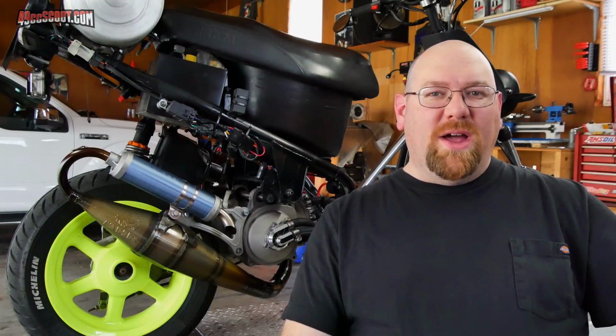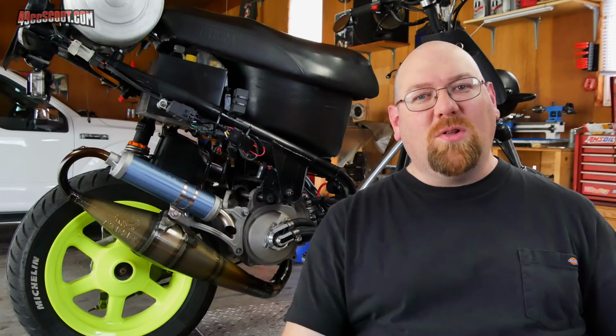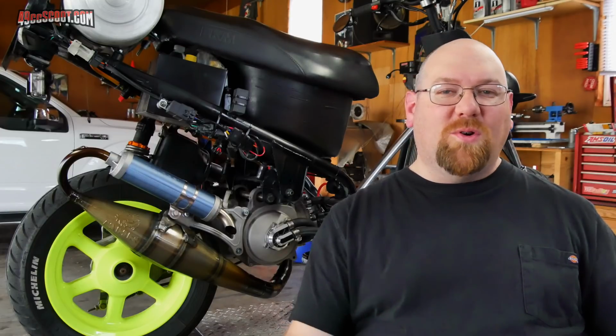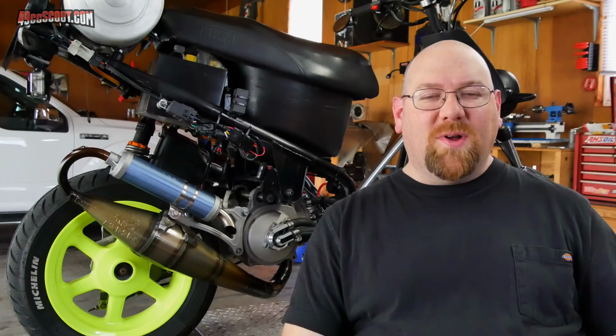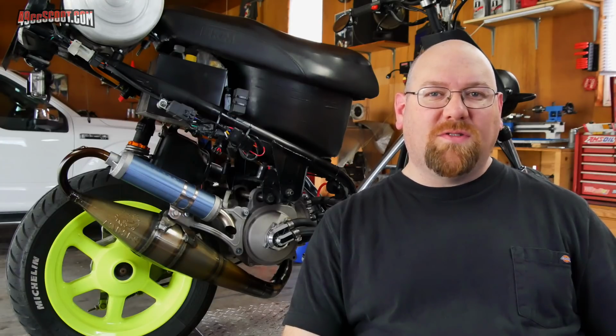And I'm thinking it might like still lighter roller weights or slider weights, but unfortunately I don't have anything around, so I'm gonna have to call this off for right now and order some weights.